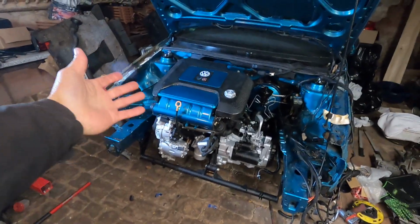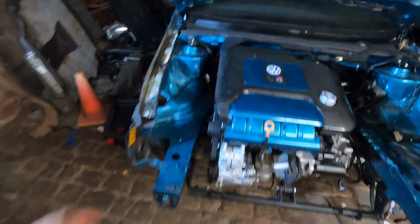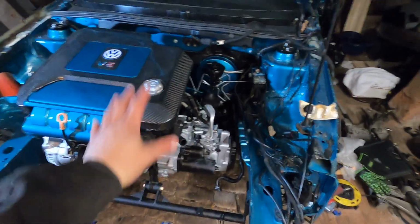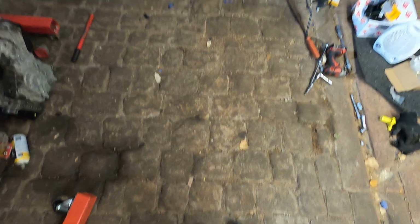So for today, I'm done. I'm just kind of taking it all in. But come tomorrow, we'll start the wiring process. I have to run the fuel lines on this side, and then I deleted all of this secondary air stuff off of this engine, which I still have over there, so I need to go through and figure out what I can actually delete and what has to go back on. But there's a good chance that tomorrow, if I can get everything together, we can try our first startup.